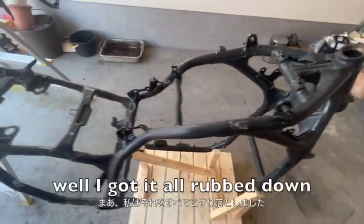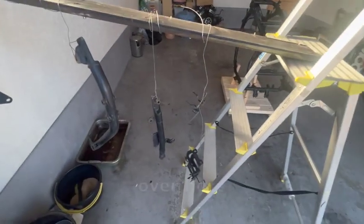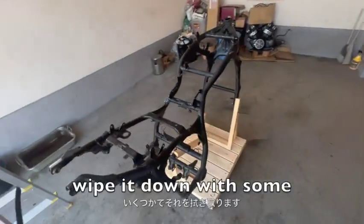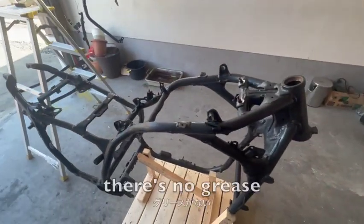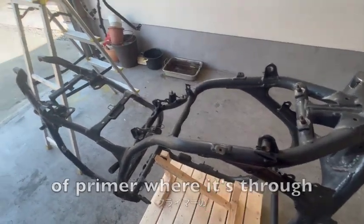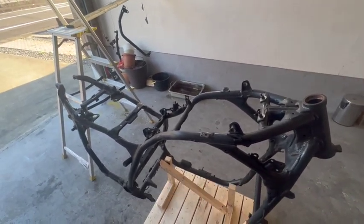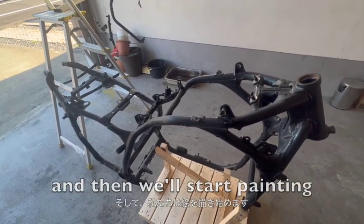Okay, well I've got it all rubbed down. And I've got all my other parts over here - my little frames and crossovers and my little brackets all done. Now all I have to do is wipe it down with some automotive thinners just to make sure there's no grease or anything on it, and a couple of little bits of primer where it's through to the metal. And then we're ready to paint the whole frame. Very exciting. Let's get the thinners out, clean it up, and then we'll start painting.